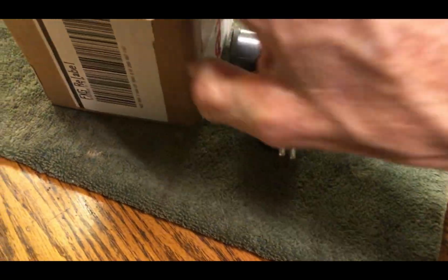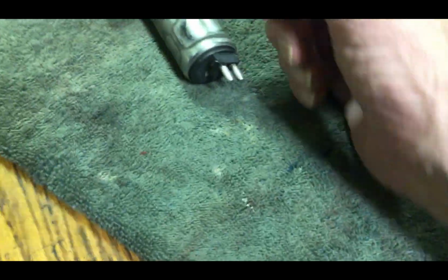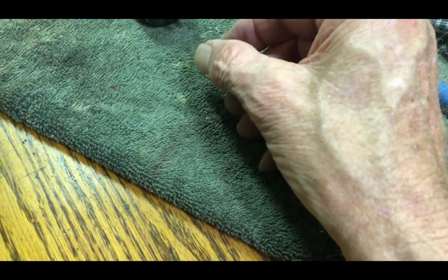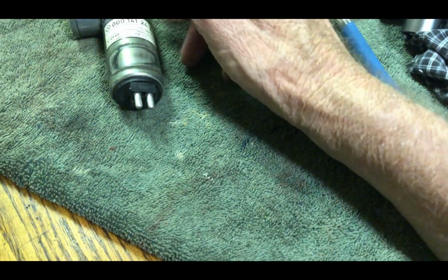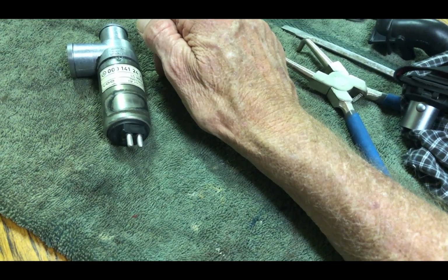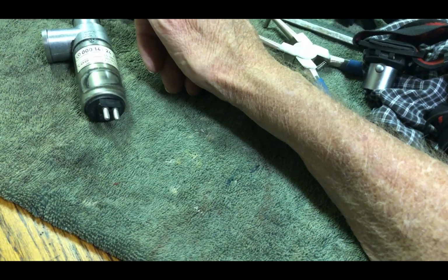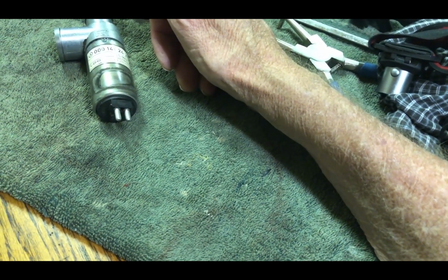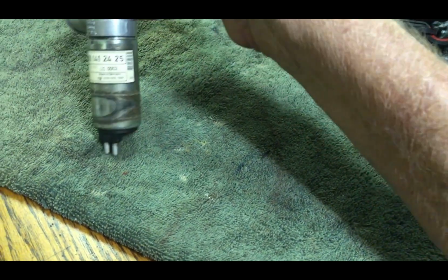12 volt, but I don't think this thing gets a full 12 volt. I saw one guy on the internet applying 12 volt to this, and then you can look in there and you can see the valve going. Another guy was using a 9 volt battery. See that valve moved, you know. But I've read that it's not 12 volts, it's something like 4.5 volts. So they're applying a ton of current to it, and sure, it's gonna move, but, you know, like 4.5 volts at 1 amp. Could be wrong, but that's kind of what I saw on the internet.